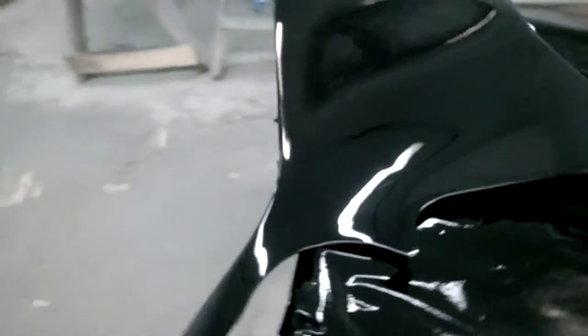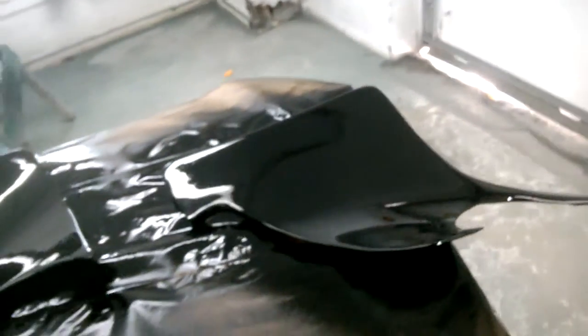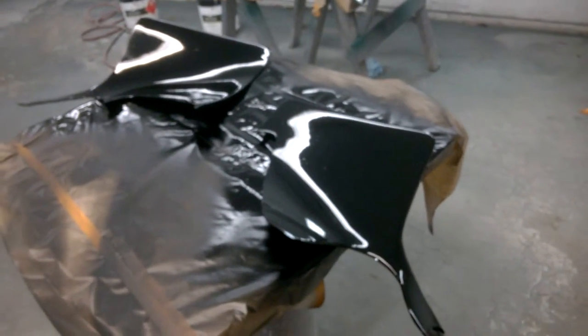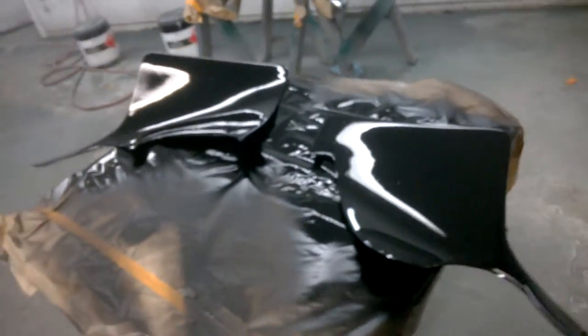So it's going to be a unique one-of-a-kind all-steel fender. These side panels right here are all handmade. This piece goes up and goes underneath the gas tank, and these go back and meet the bags - you'll see it when it's on the bike. Both of these started out as fiberglass - actually two gallons of fiberglass, a bunch of mat, and some cardboard. I made these completely from scratch. You can't buy these anywhere.